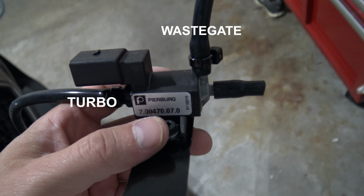When it comes to connecting the new EBCS, the vacuum line that comes out underneath the electrical connector is the one that goes to your turbo, and then that line that's coming perpendicular off the top of the valve, that's the one that's going to go to your wastegate. Now, as you'll see in the next video clip, it was a bad idea for me to preemptively connect these vacuum lines, as it does make it a lot harder to get them connected. So don't do what I did, but I guess this is a good visual reference.